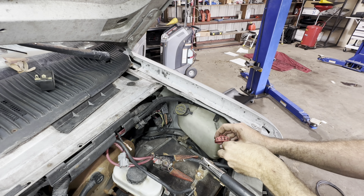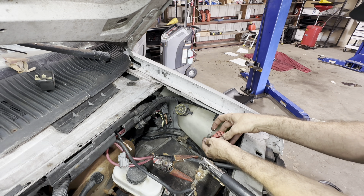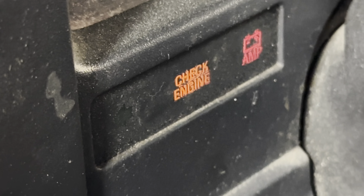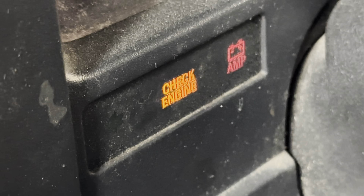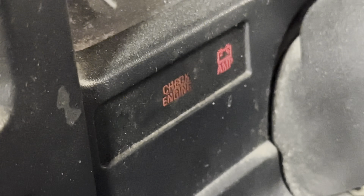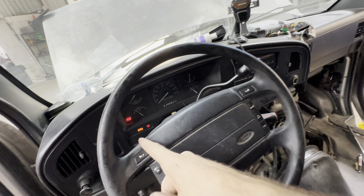Paper clip in hand — we can use a jumper wire but a paper clip will suffice. So what we do is jump these two connectors right here, then go into the cab and key the thing on. It should flash us the codes that are present. But let me show you what it does. Self-check will not work — see how it tries to flash but it won't flash properly? That's not how it's supposed to be doing this. It was just doing a half-faded flash the entire time. So I proceeded to attempt to diagnose this without retrieving trouble codes — I kind of disregarded that for the time being and went on to try to diagnose this in a more analog fashion.